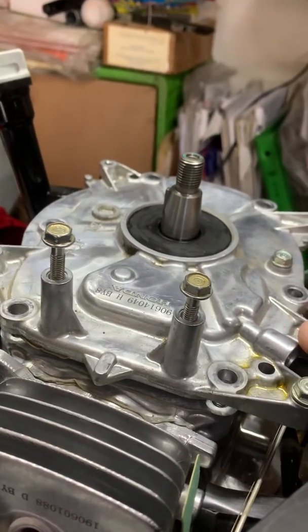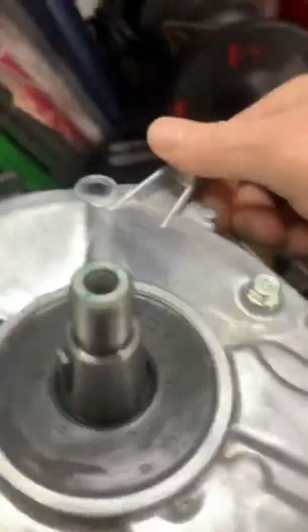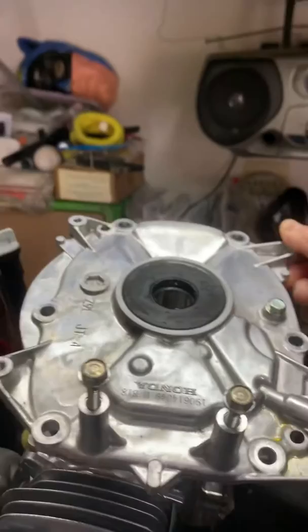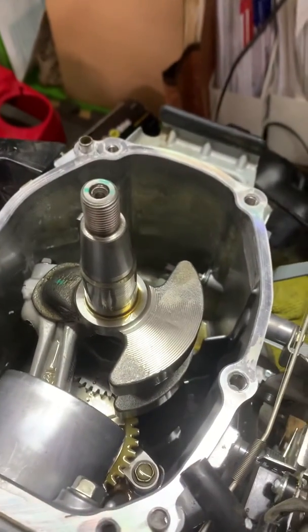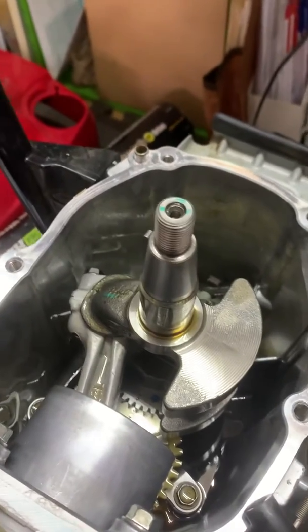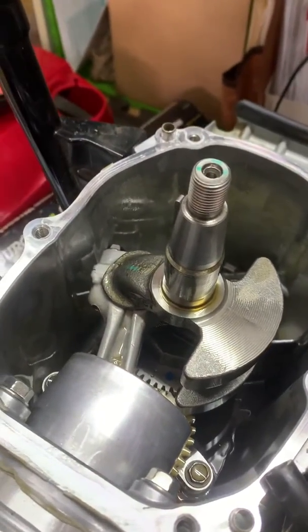What I do like about this engine is the simplicity and the organization of how it is put together. As you can see here, the top — all of these bolts are torqued to 20 foot-pounds. The entire engine assembly is in this sealed drum and operates all within this. There are no two pieces like the clamshell design of the old HRX's.